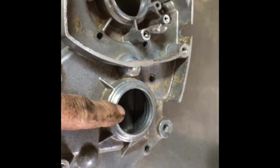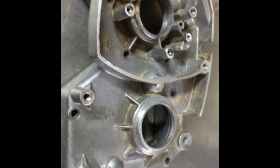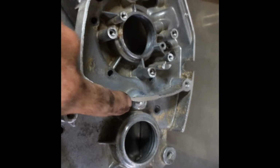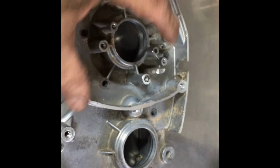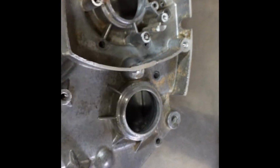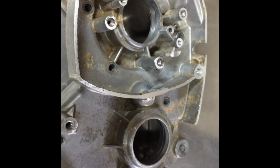The way that happened, that's the drive shaft there, drive sprocket. Chain snapped, goes flying up into there, smashes that. And then if there's a crack there, if you drive through mud and shit, the magneto gets wet. So that's why it's got to be sealed. All that's sealed off. Alright, that's done. She's off to the aqua blasters for a few parts.